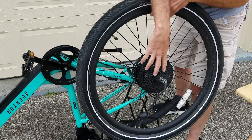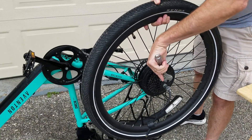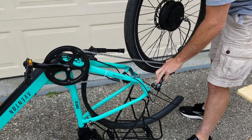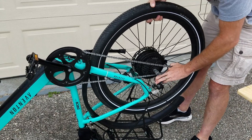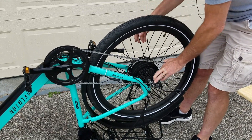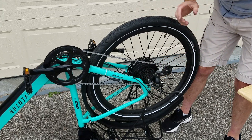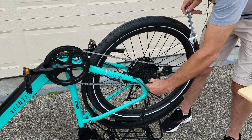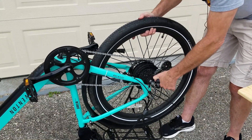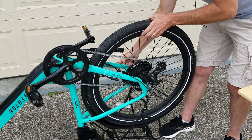Let's put it together. Remember the orientation on your torque washer — that's important. A little trick: use your adjustable wrench to reposition the axle a little bit. You want the keyway up. Put it on your smallest cog, watch your wires. I can already see my torque washer already turned, so grab that wrench, spin it around, and make sure your torque washer keyway is up. We've got that in place, and then it's just a little bit of finagling. You've got to get it into your brake — disc brake on the other side. Start dropping it in.